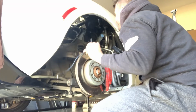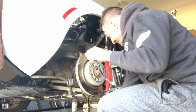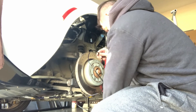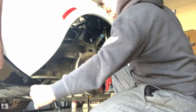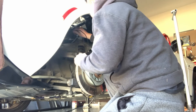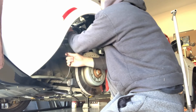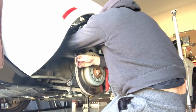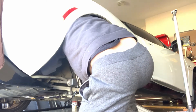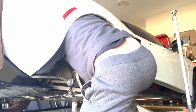I wanted to include this clip for two reasons. One, I wanted to show how much — or rather the lack of being able to see the engine from this side. I obviously have the wheel off and the inner wheel well out. Where I just went through is the biggest gap you're gonna have — that top left, to the rear of that strut. Just in front of that strut there is another little gap, not very big at all. The majority of your belt install is going to be above and below, and I would say the majority of that is going to be below.